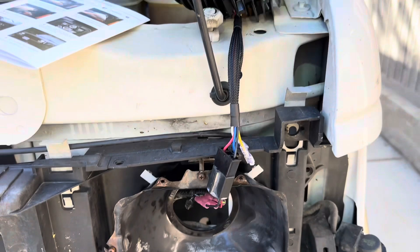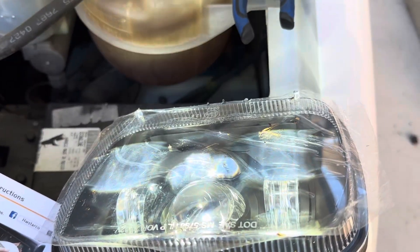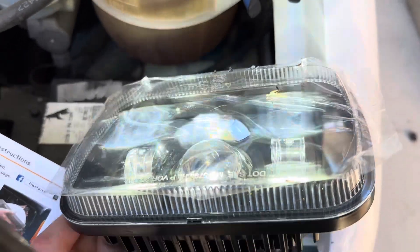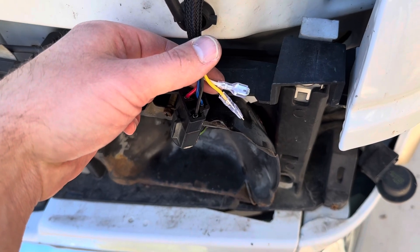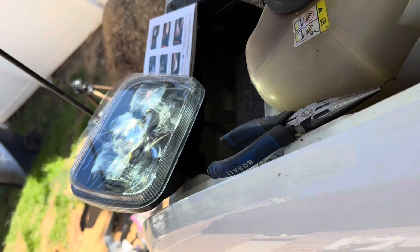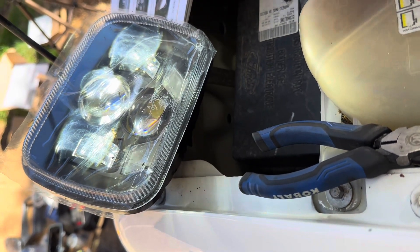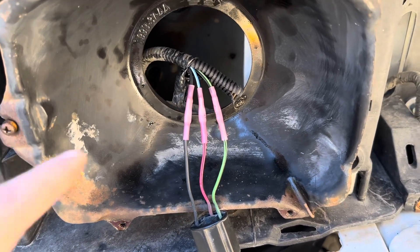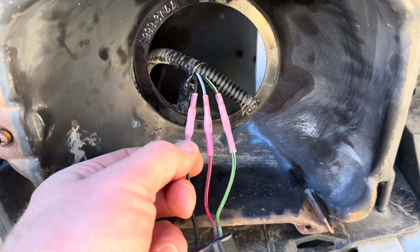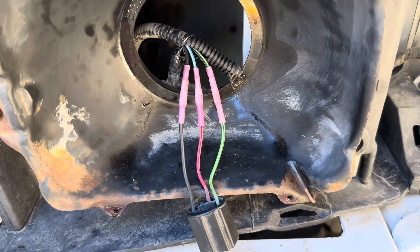The lights are wired up now and appear to be working fine. The blinking is just a camera effect — all LEDs blink on camera, but to my vision they're not blinking. These lights do have a couple of extra features: one for a daytime running light and one for a blinker function, but I'm not going to be hooking those up. We've got the low beams and high beams working. I've heat-shrunk the connections — they have a heat shrink with glue, so once shrunk they're glued in place and weatherproof. I'll follow that up with wire loom to protect from sharp edges.